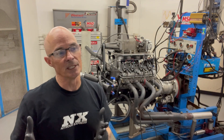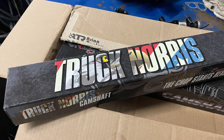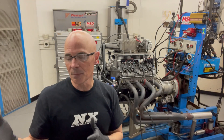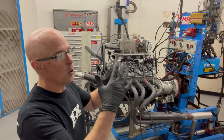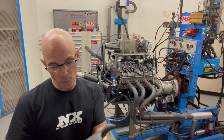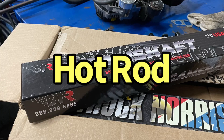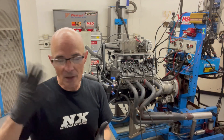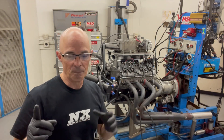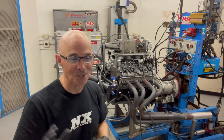Now I want to replace the camshaft. We have the Truck Norris camshaft in the 4.8 — it seems to work pretty well, and yes, it is a turbo cam and also an M90 blower cam. But I want to put something bigger in it. We need to make the naturally aspirated combination more powerful. So we're going to replace the Truck Norris cam with the Brian Tooley Racing hot rod cam. We know from previous testing on the 5.3 that the hot rod cam makes more power than the Truck Norris cam. But I had one problem — these factory 706 heads are terrible.